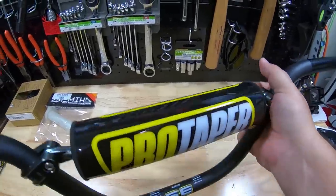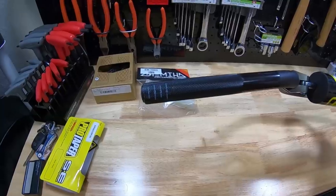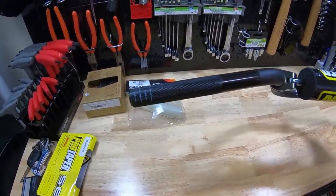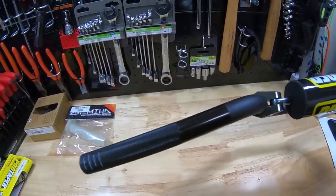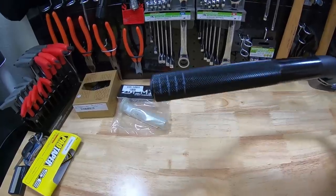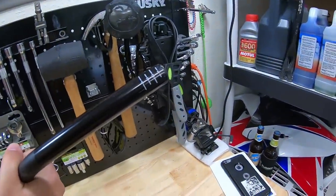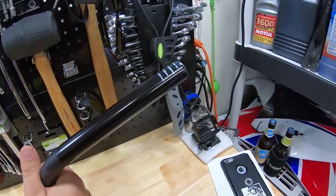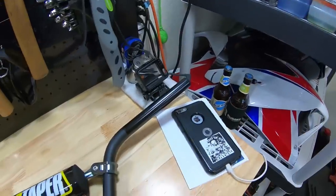You've got your middle pad, which is traditional Pro Taper — I'm going to be changing that out. On the clutch side, the bar is knurled so the grip sticks on better. I'm just going to use some hairspray to stick the grip on rather than grip glue. It does have markings on each side so if you want to trim the bars down, you can — those measurements are already set up for you. No knurling on the throttle side because you don't want the throttle tube getting hung up on there.